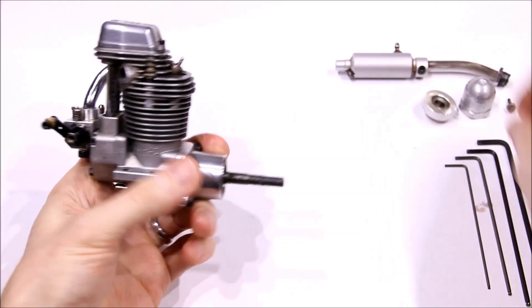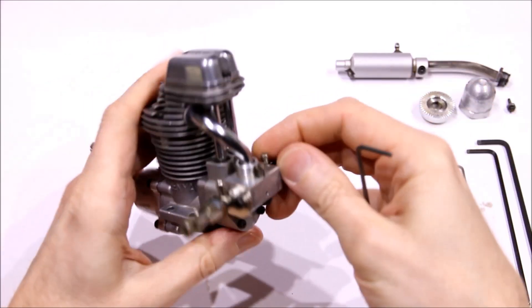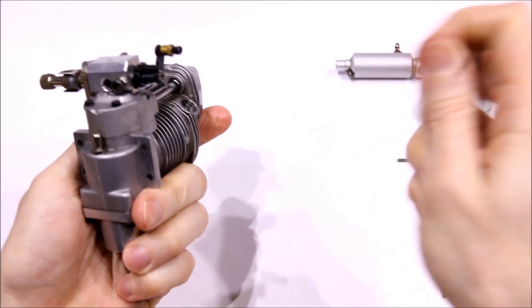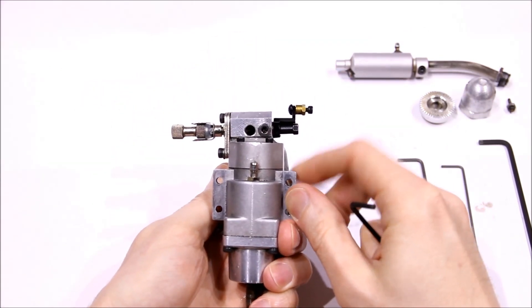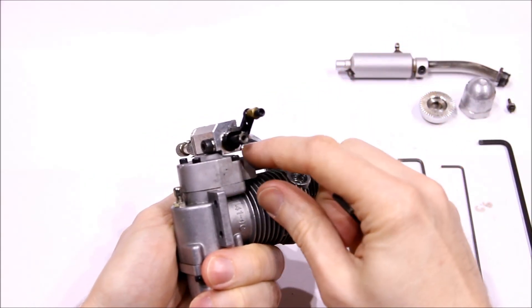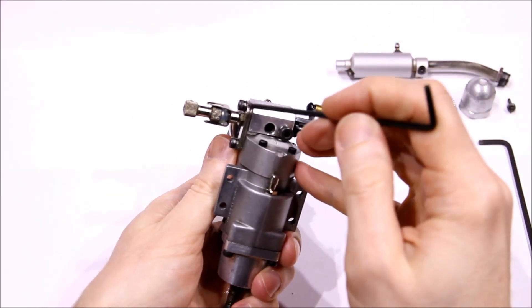The drive hub just slips right off of the shaft. Start by taking off the carburetor. On most of the smaller Enyas, it's held on with two screws, but this one's tweaked a bit. You can see that the carb is offset a bit — the side has probably been hit or something, there's a gap there. It just doesn't affect how it runs, but it can be fixed by straightening the bracket.